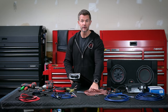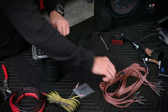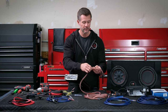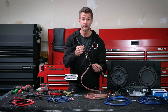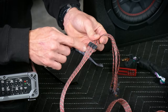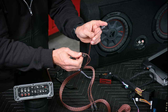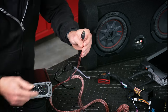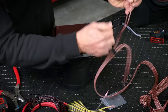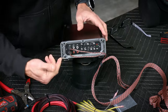One more portion we need to talk about: connecting the RCAs to the amp. We'll provide a six-channel RCA regardless if you pick up a four channel amp or a five channel amp — if you pick up a four channel amp, you're just not going to use the sub portion. The RCA harness is labeled F, R, and S — that's front, rear, and sub. Picking up the two RCAs for the front, red is red and the black is the white. You're going to go over to amp one — which is your front — and plug red with red and white with black.